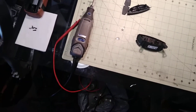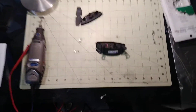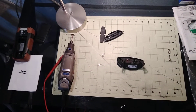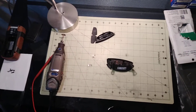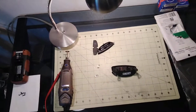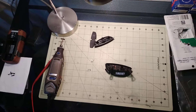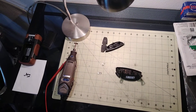Also, if you don't want to mess with sticking your leads on these pins and pressing the button, what you can do is just on the back ohm-test from one point over to another point, and that should give you the resistance. My light is coming on now — I have power on the red and orange to the brake light switch, and I ohm-tested the brake light switch and it's good.